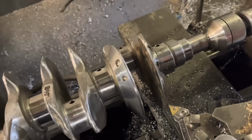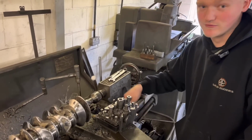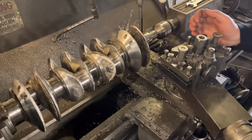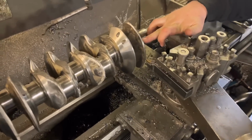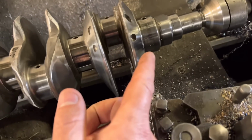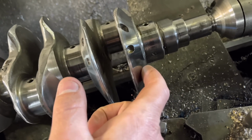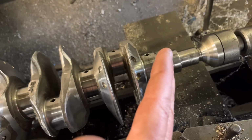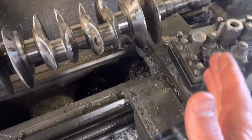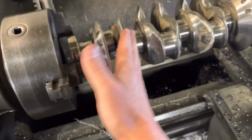And then once you've got your thickness, you start adjusting this round, feeding that in again. You get a bit more of an angle, and you keep repeating that until you get it how this is. I see what you're saying. Yeah. So basically, you start off with a steeper angle. You get the width of the front here how you want it, but you probably end up not where you want down here. So you just adjust the angle in until you cut it down to where you want, and then you keep that angle, note it, and do the same on each of these 4.